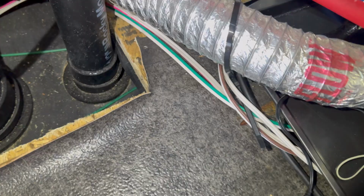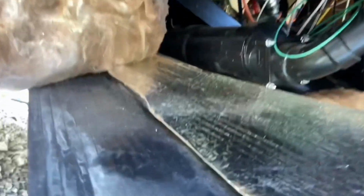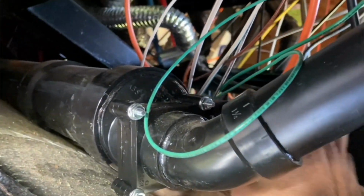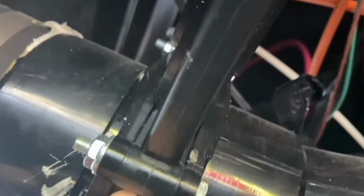Now, I mentioned earlier that sometimes these cables break. It's not that big of a deal to actually replace these. Like I said, you can follow the cable behind your wall and see where it goes, and that's where you're going to find the gate valve. Sometimes you can actually look down over in your basement, look down below, or you may have to drop the coroplast, which you're going to have to do if you have to replace it, and you're going to find where that gate valve is located amongst the plumbing.